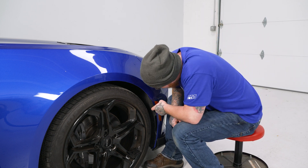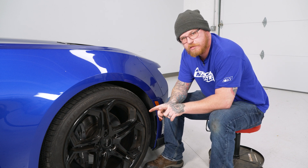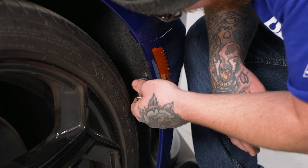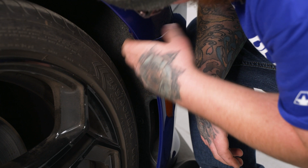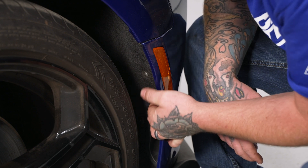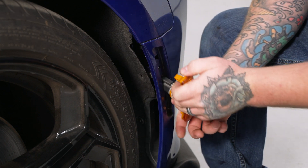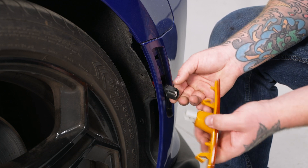What we're going to do is remove this one screw here for the fender liner so we'll be able to pull it back enough to reach in and pop our marker light out, because it's just held in by two little clips. Go ahead and pull that screw out, then pull the fender liner back a bit. Now pop this bottom clip out first — just reach behind it and push that out. Push back on the fender liner, pop it out, and go ahead and unplug the marker light by pressing down on the tab and popping it right out.